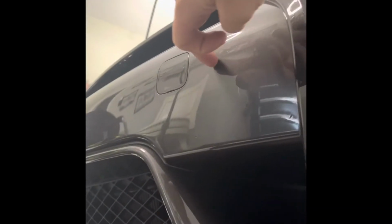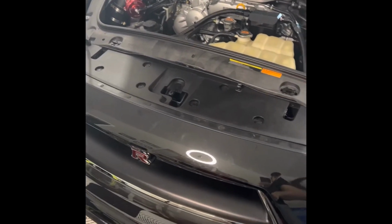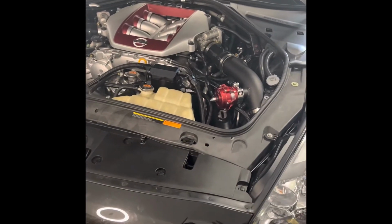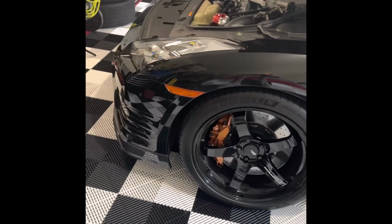And as the bumper comes off, you got to take the foam piece off. That's behind here. Slide it straight out, and then once you do that, you'll have to take a bunch of bolts off the metal bumper that's behind that, the aluminum one, and put all that to the side. And then after you get all that off, it's easy peasy. The hardest part is putting the fender liners back in. The bumper was so-so to put back on, but it still wasn't that bad. I was doing it by myself, so that was a little rough.